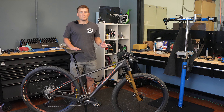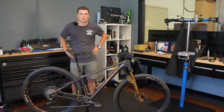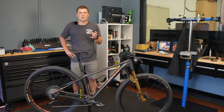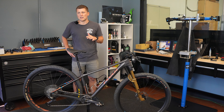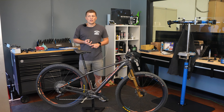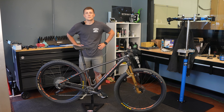I threw in inserts — you might think inserts and XC is a little crazy, but a CushCore is around 130 to 150 grams. These Vittoria Airliners are only 50 grams, so you really don't lose much. I kept running 18 PSI, noticed a little crunching noise, thought maybe I was damaging the insert, so I went up to 20 PSI. The insert gives me comfort and eliminates that bobbing feeling from higher PSI — the bike feels more dead in the wheels, which is really nice on a hardtail. I'm using SSB sealant — it coats the tire well and works well with the insert.